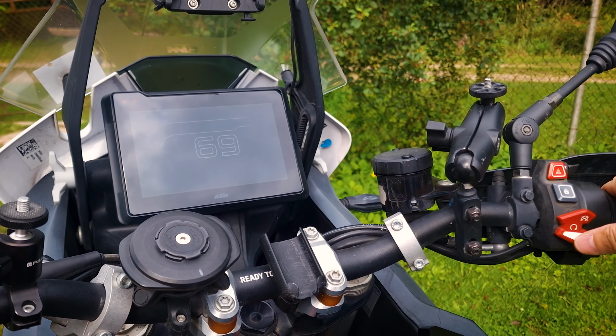This sensor itself is located behind the left engine cover, and its connector is closed by the tank. So you need to remove the tank. Before that, I had a previous generation Super Adventure. And there, removing the tank was a difficult task. This bike has a completely different tank, and a completely different plastic mount. I even felt like it was made easier. I was especially pleased that it is difficult to damage the plastic when removing it. In the previous version, the inner plastic sometimes broke.